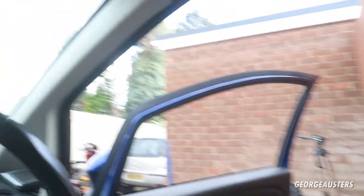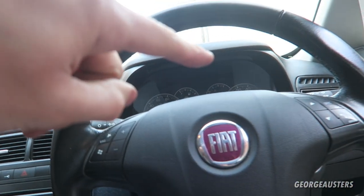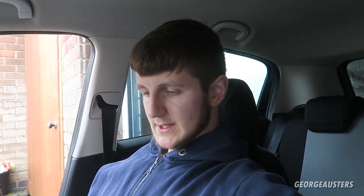We've positioned the car half in the garage. We're going to start at the back because you want to start at the wheel that's furthest away from the brake servo. The brake servo is usually on the driver's side at the front in the engine bay. So we're going to start on the rear nearside, which is the passenger side brake drum, because these have drums on the back, not discs.